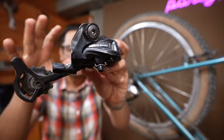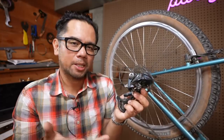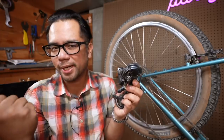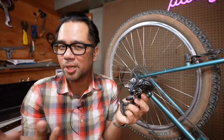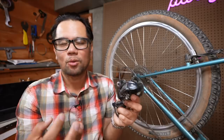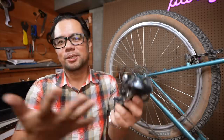When there's no cable tension on a normal derailleur, the springs want to move to the smaller cog or the harder gear. This has a couple of implications. If you want to get into a harder gear, since the spring is working in that direction, it's going to jump to that harder gear a lot faster. One downside, however, is if there's something funky going on with your shifters and it's not holding tension or it's not properly adjusted — we've all been in that situation where you're putting down the torque and the gear slips and all of a sudden you're in a harder gear than you want.